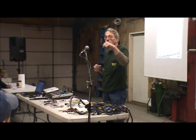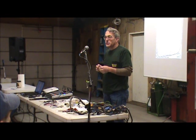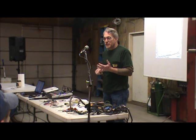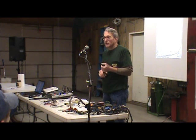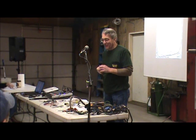Yes? One thing on fuses, British spec fuses versus American fuses. Right. They're not the same. Correct. What they list on there, for example, a 35 amp fuse, and I'm not the fuse expert here, but what's listed there is not the continuous rating. So a 35 amp fuse is actually 17 amp continuous. 50 is something else. Again, I'm not the expert on fuses, but you can't just go out and say, oh, it's 35 amp. You will have a problem.